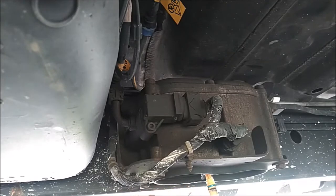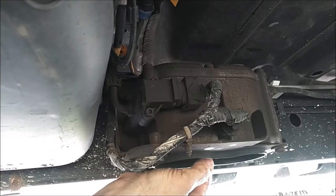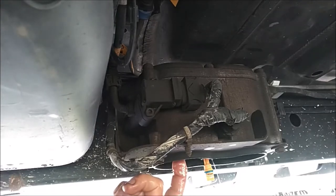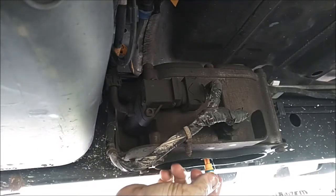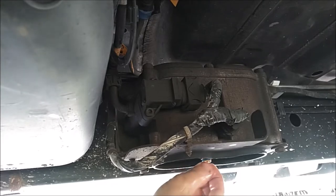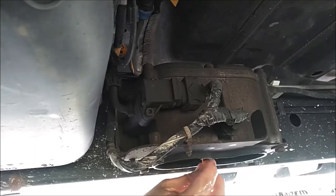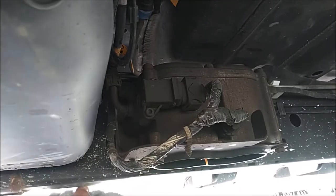I like the fact that it stays in place so you don't lose it. A lot more diesel came out than I thought, but I've got all the pressure out of the lines. If I had just taken the filters off without doing this, there could be excessive pressure causing fuel to splash everywhere. Now that I've got the pressure off the system, I can thread the tab back in clockwise — making sure I don't cross-thread it. The blue o-ring is visible, and diesel makes a pretty good lubricant so I don't need to lube the o-ring separately. Got it hand tight. Good to keep that rag handy.